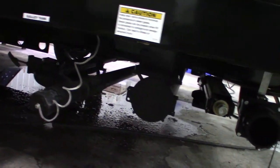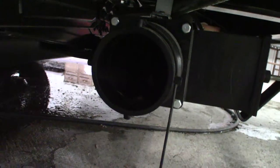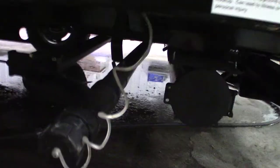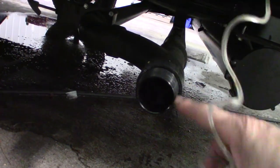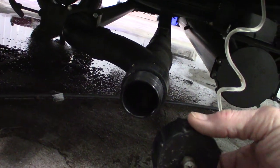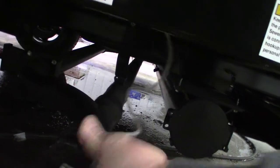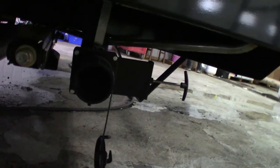When it comes to your black tank — which is toilet water and waste — this is where you dump it. You get a hose with it so you can hook it up at the dump station. The gray water, which is sink and shower water, hooks up right here. You get an adapter so you can hook up a garden hose or push-on hose and direct the water wherever you want — it's not toilet water, so it's not as critical. And this device here is where your dump hose is stored when you're not using it, keeping it out of the trailer and tow vehicle.